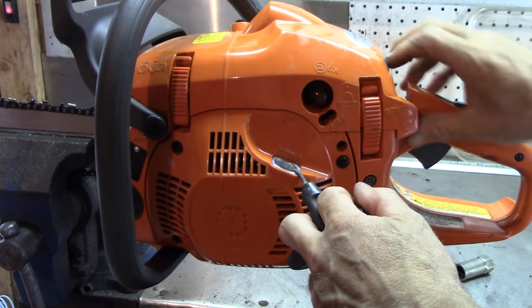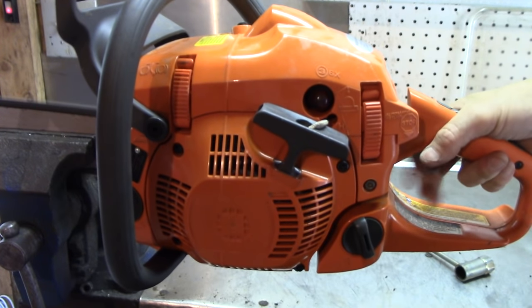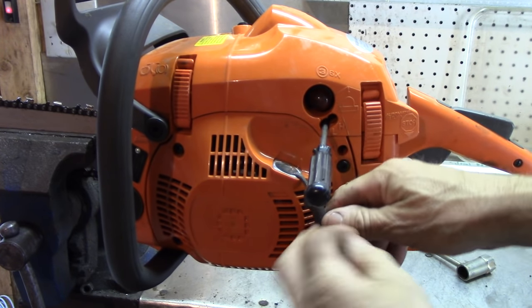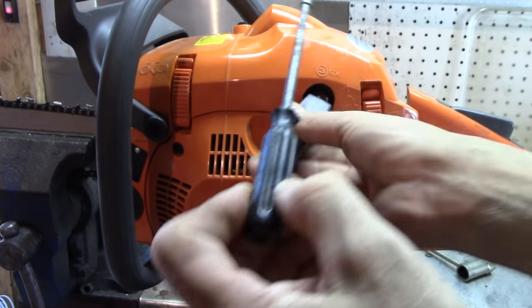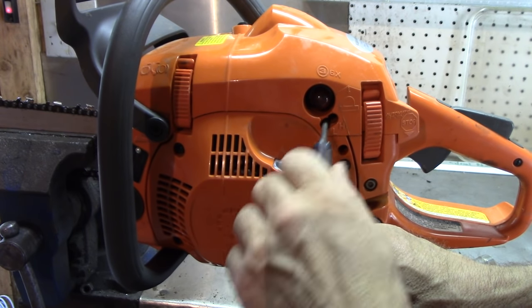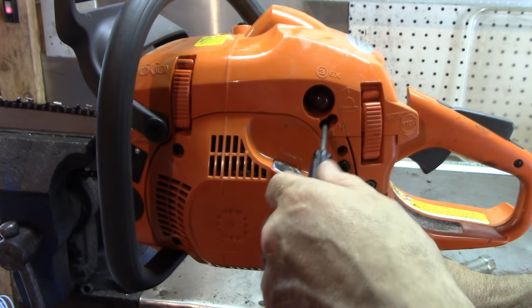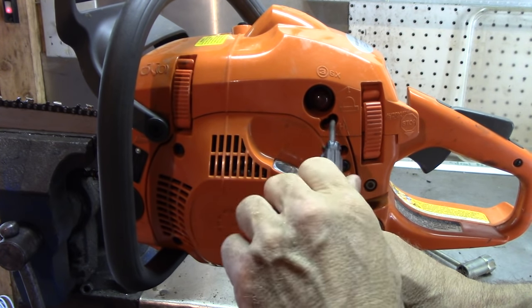Let me see if I can start this. I've got my finger on the throttle — see if it'll start. It won't stay running, so the carb is all the way back down. What I do is go in there; I set my tool up — there's writing on it and I like to use that writing in the center so I know how many times I'm turning it. I'll go in there and do one turn, one and a half turns. Same thing with the high — I'll go ahead and back it out one turn, one and a half turns.